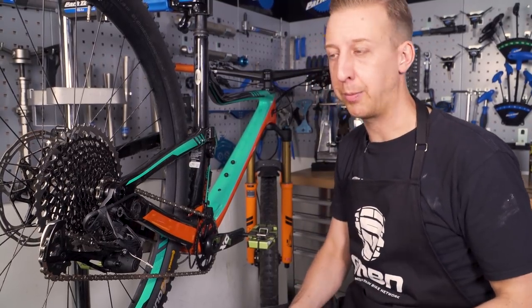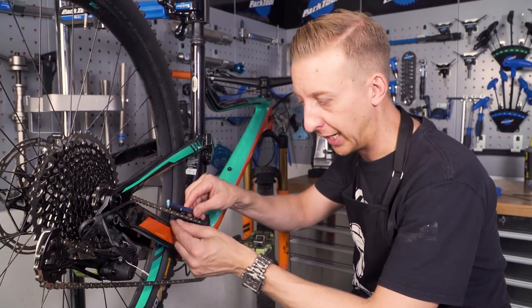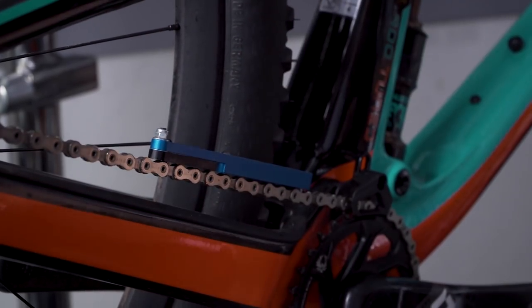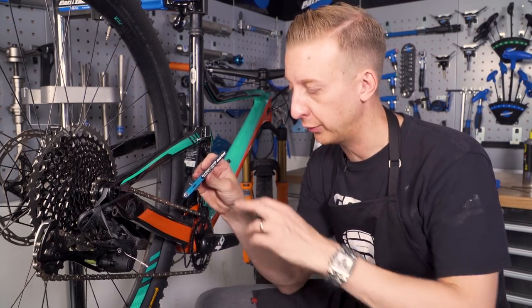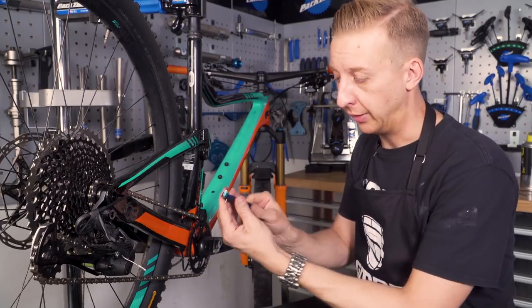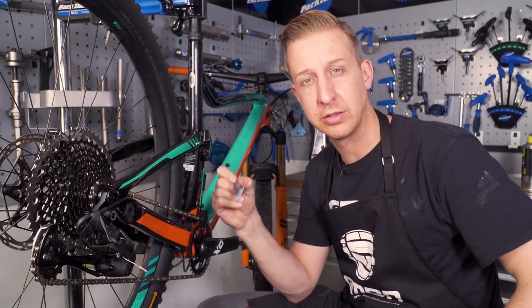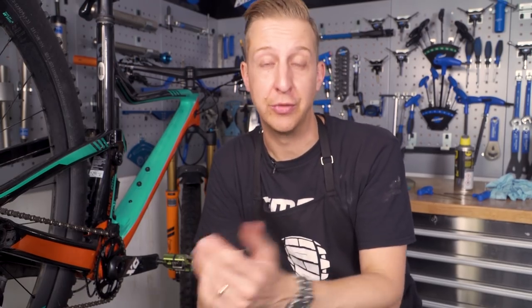Following winter is a good time to replace things on your bike because you've had maximum use in the bad conditions. You want to start the year off with a nice fresh drivetrain, so if you need to replace your chain, now's the time to check how it's wearing. Use one of these chain checker tools to check the wear. This one is so new I can barely get the chain into the tool — the bike's literally a few weeks old, so as expected it's not worn at all. It does depend if your chain is 8, 9, 10, 11, or 12 speed — there are always recommendations on the checkers. New chain reads between 0.25 and 0.5, and you should replace it at 0.75. If you change the chain in early spring, just before your summer season kicks off, you're going to have a nice fresh drivetrain with accurate shifting for most of the season.